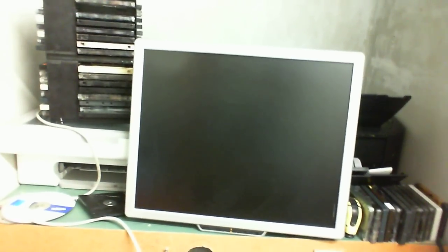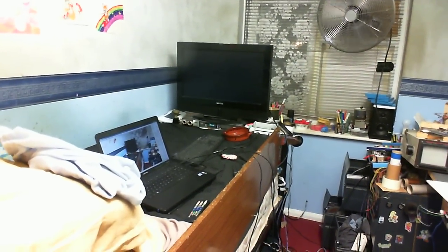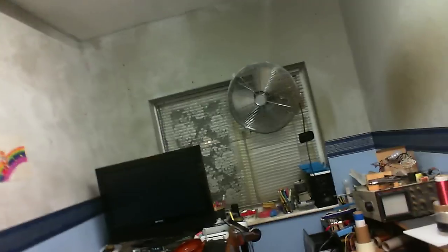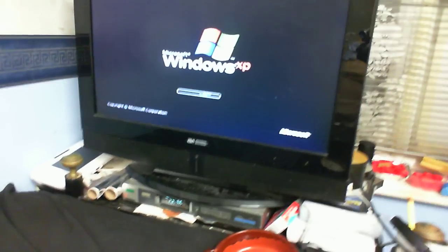Now because I'm doing this video, it probably will work absolutely fine first time. But anyway, I want to make sure that it wasn't the graphics card in this computer that's messing up. So what I've done is I've got my TV over here also connected via the video out — that's only composite video, but it's good enough for the test. So I'll turn this on and let's see what happens. The monitor should come on but you don't see anything on the monitor. We've got some weird stuff going on there, but if you look on the TV, while Windows is booting up you can see it's not a problem with the graphics card because we do have Windows showing up there, but on the monitor — nothing.